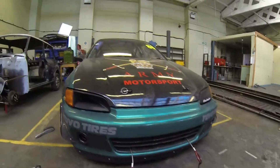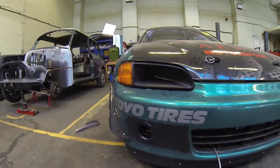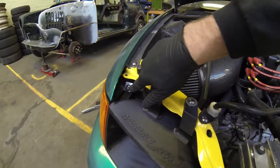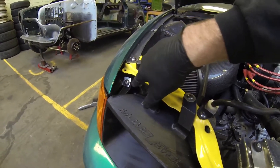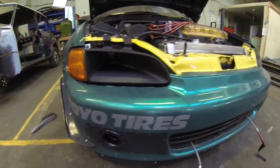That's in and it fits quite nicely. Obviously it's not a factory fit, but none of the panels have ever really lined up that well on this car. There was just one thing I had to do — put a riv-nut in the bracket on the headlight assembly itself, as a nut and bolt either side would have been far too fiddly. Riv-nut went in fine and it's all bolted in. Pretty happy with that, looks sweet. It's also really lightweight — lighter than my old plastic headlight duct, which is a nice weight saving bonus.